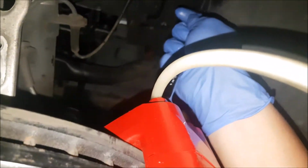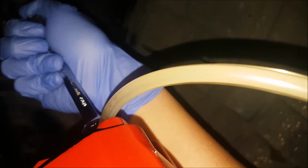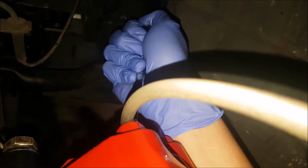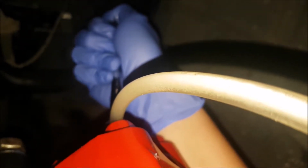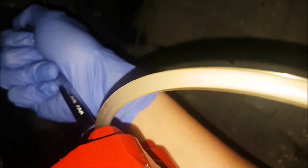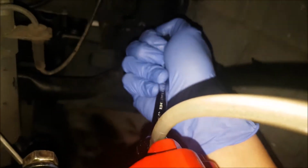You can see I have a bunch of air in the front. See, it looks like foam, the aeration in the fluid. Cracking it. It's looking better. Give me 5 pumps again. Push and hold. We're gonna keep on going. Okay, give me 5 pumps again.